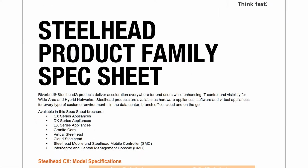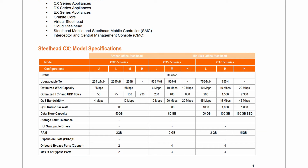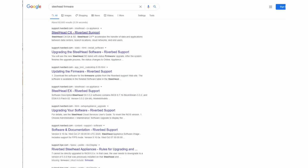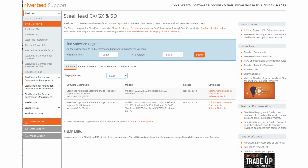This device comes with a 160 gigabyte SSD and 4 gigabytes of RAM. I was lucky enough to find one on eBay for $75, but although it's great value for a sturdy piece of hardware, keep in mind it runs on 32-bit architecture. This means you won't be able to run the latest pfSense, since pfSense moved to exclusively 64-bit releases since version 2.4. So if you want the latest software, you'll need to grab different hardware.